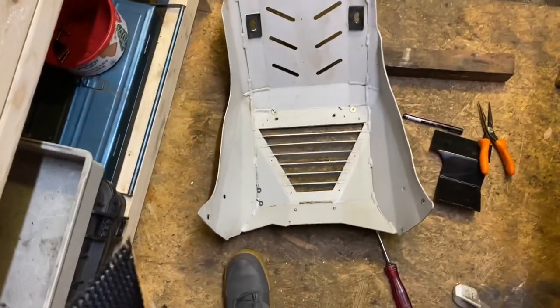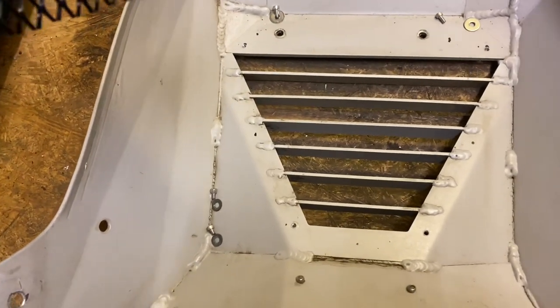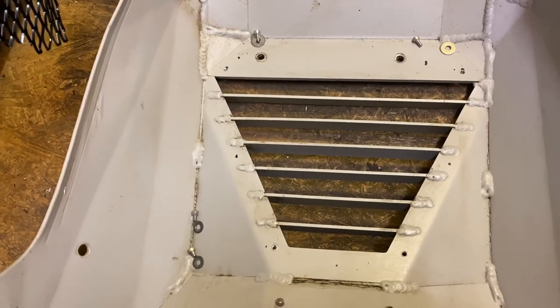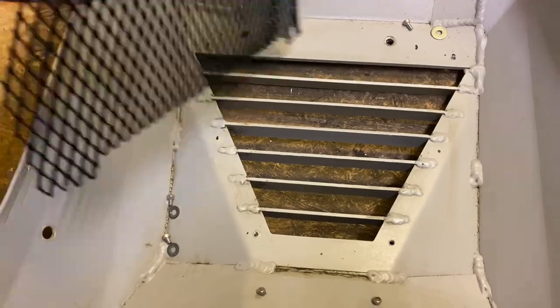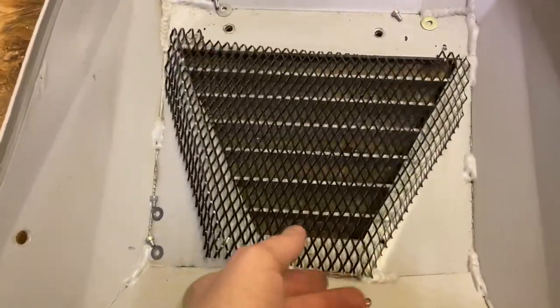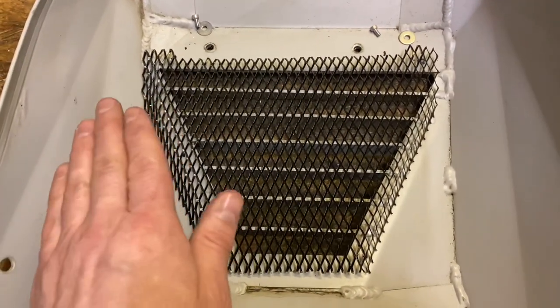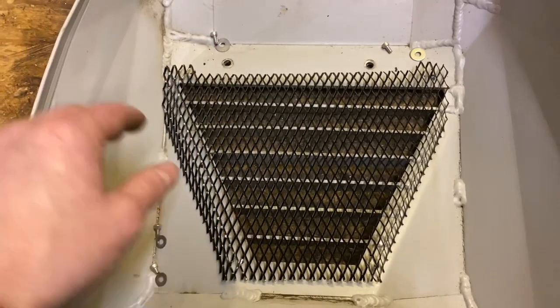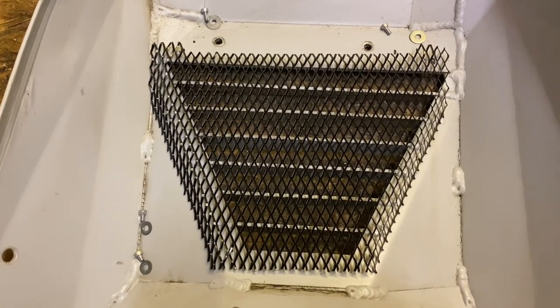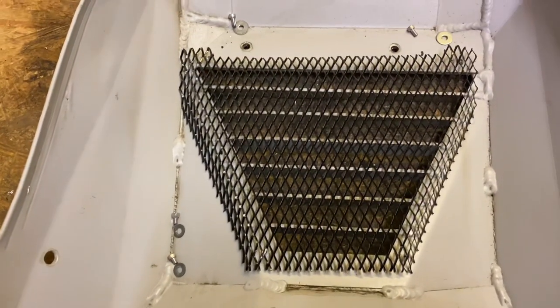I'll do this mod anyway and see how it works in mud. So here's my little skid plate, upside down. I was thinking of riveting it but I couldn't find my rivet gun, so I drilled some holes — one there, one over there, and one up there. I bent it a bit so when I force it down with the bolts and washers there's no loose piece on the side. I drilled and threaded it M4 thread.